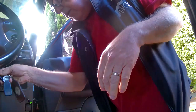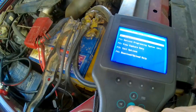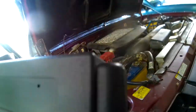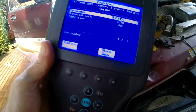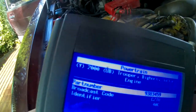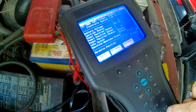Get the ignition on, get the Tech 2 fired up. I've brought the Tech 2 out here because we need to turn on the ignition. If you get a 'turn on ignition' message, that means you haven't got your ignition turned on, so it can't communicate with your system. Once it connects, what we need to do is go to Miscellaneous Tests.